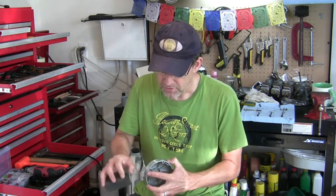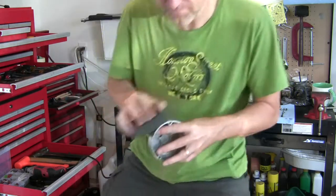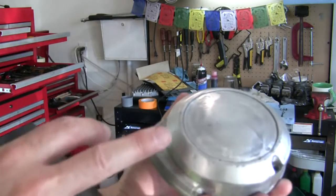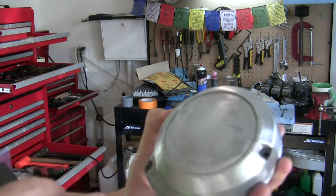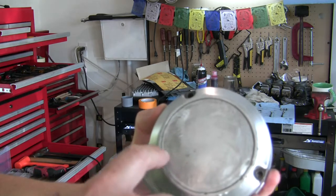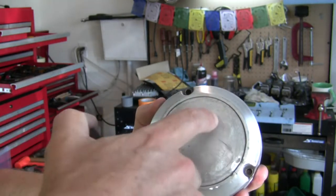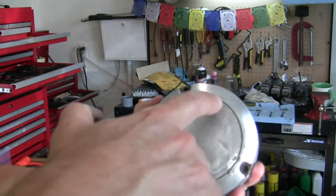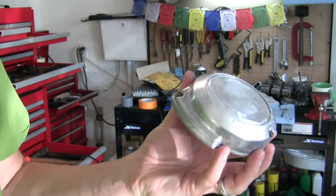Right now it's about sanding away all of the tarnish and black — there's a clear coat on these. At the same time, I'm painting parts outside the valve covers and that kind of thing. Start out with about 300 grit. It's pretty rough right now. Difficult to get into areas like this, but the screw is going to go there anyway — the screw that holds it on. I took that Dremel and just worked around this edge to try to get a more defined line. I'm not going to put stickers that say double overhead cam or Suzuki on these. I'm just going to polish them and let them shine. Starting out pretty rough, 300 grit or so.